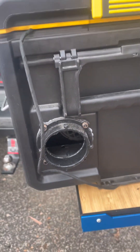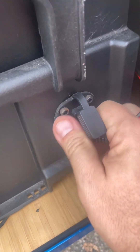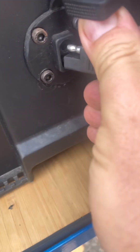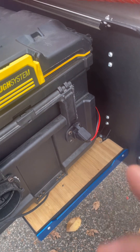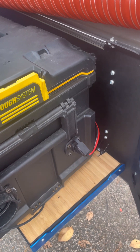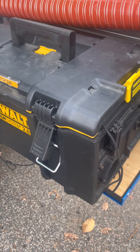On the outside on this side I've got another 3D print — that's just an air inlet, so you can see the inlet of the heater right through there. On this side is where I've got my power coming in. The power is set up with a standard SAE plug using a flush mount SAE. One thing to remember when hooking that up is the polarities are often swapped, so if you're having trouble just switch the polarity and that'll often fix it.